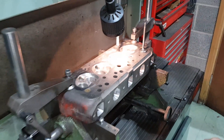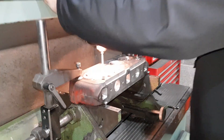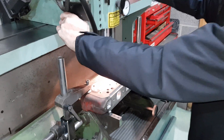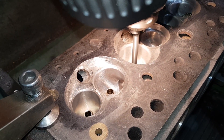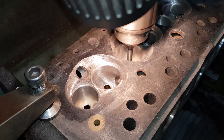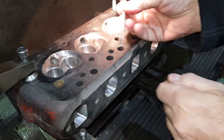Just to show you again — we put the pressure on so the head is floating, locate the reamer in the top of the guide, take the pressure off to lock the head, pull the reamer out, start the machine, and down we go. You can buy hand reamers which will do the job, and it's fine to do it by hand at home, but we do an awful lot of these so we do everything mechanically, making sure everything is perfectly vertical as we go through the guide.